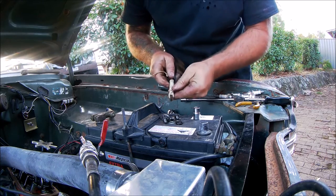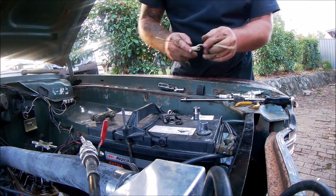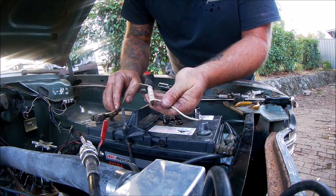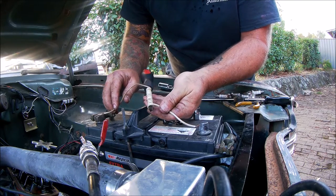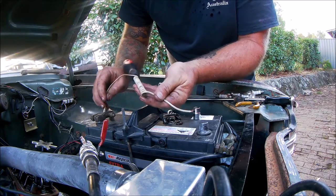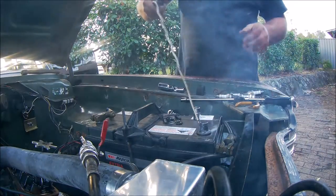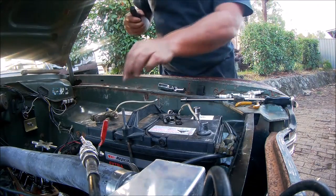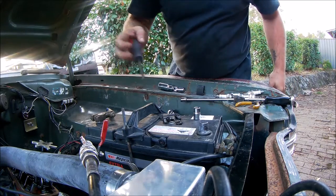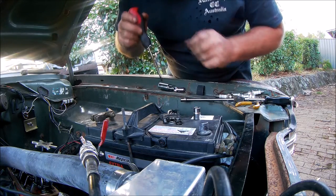And to prove this isn't really magnetic, look, there's nothing. So, around the screwdriver and then touch it to the terminals for a bit. Let it smoke up. Come on. Burning myself, there it goes. Alright, you know it's ready because the wire will melt and get hot. Same screwdriver, magnetized. How good's that? Let's get these collets out.